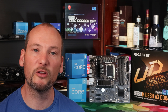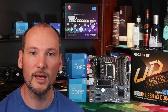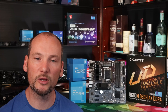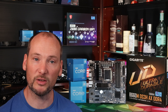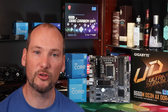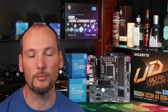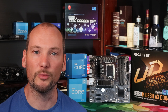If cost is a primary concern, this motherboard does work — it's got a decent feature set overall, and so long as you're prepared to put a little time in to make sure it's performing optimally, it will serve you well. We'd recommend it for an office build with an i3, where those multiple display outputs could come in handy and it will run that CPU with no problems. If you're looking for a more general-purpose or gamer-centric build around an i5, we'd only consider this motherboard if you really are counting every dollar. We think it's worth spending a little bit extra for a slightly nicer motherboard like the Asus TUF, Prime, the Gigabyte Gaming X, or the MSI Pro B660M-A or Bazooka — all of which offer rock-solid performance, much less hassle setting up, and an equivalent or better feature set.